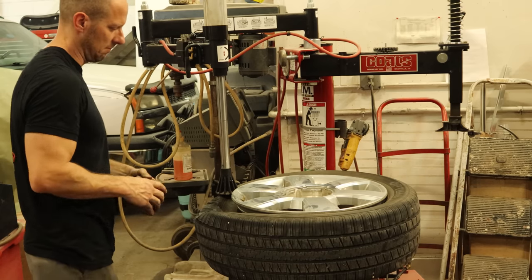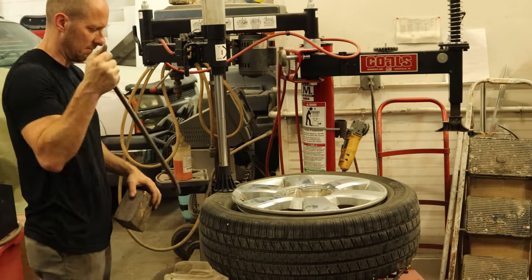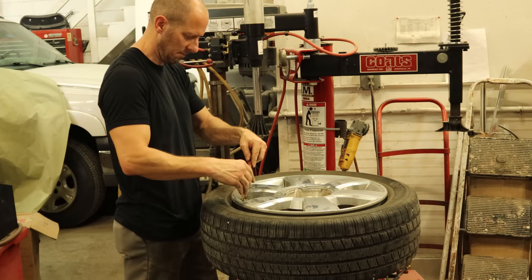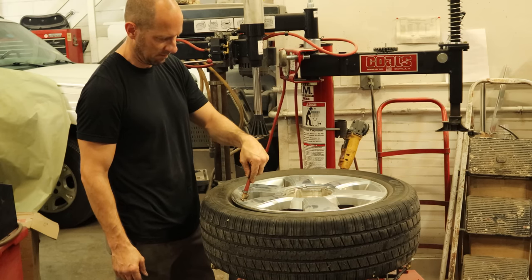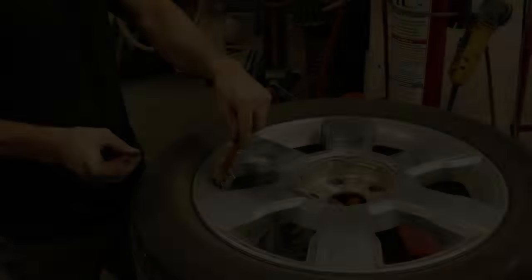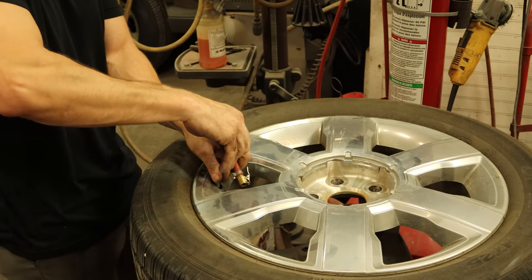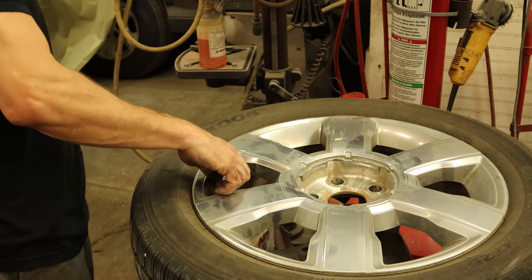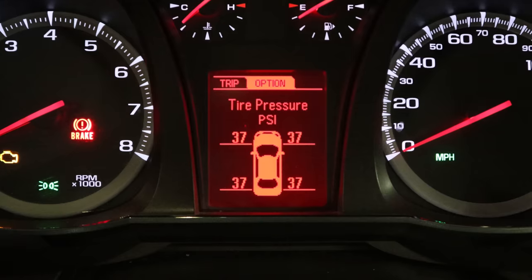Hopefully don't drop the socket, the sensor, or the screw down in the tire and have to break it down or go fishing — it's actually easier to break it down because you can never get them out of there. We'll take our time. There we have our new used one, free of charge. I don't know how long it'll last but it'll keep the customer happy and turn the light off. Tighten the screw back up once we don't drop any tools down in there. Now the tire was underneath the sensor and I really didn't want to break the new sensor. So now we can fill it up and put it back on the car. We'll top off all the other tires so they're all even. We'll put the valve core back in and fill it up. Getting pretty good at that. I'll check and make sure all of our tires are reading the same — and they are, tires are all happy.